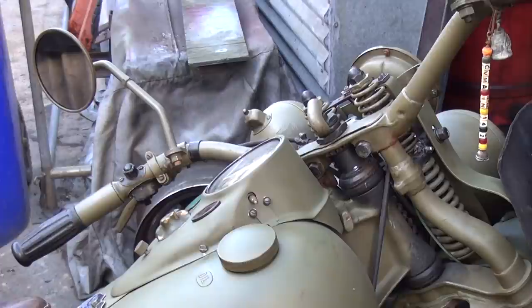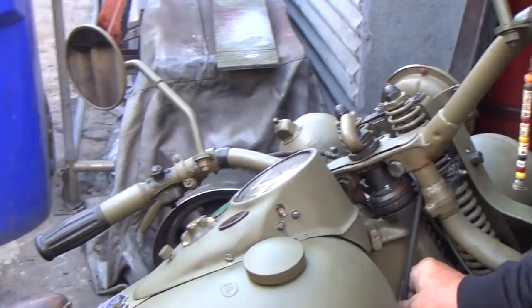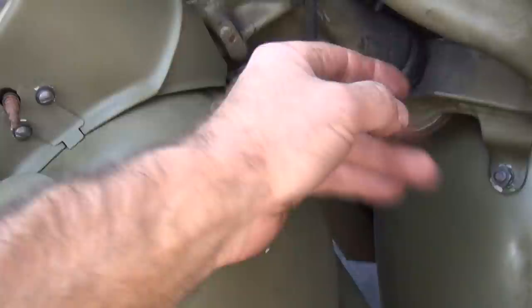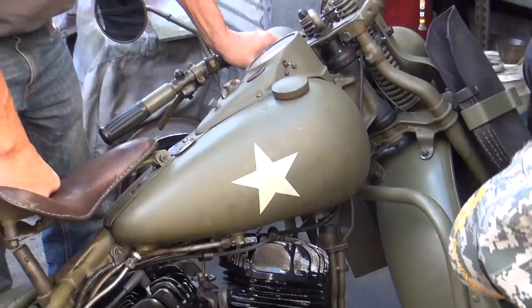you didn't check all this stuff to see what happens when you turn the forks. Now, is that a throttle cable coming down right there? Yeah. How come it's so tight? I don't know. It's not supposed to be a guitar string right here. It's supposed to have some looseness to it, so that it doesn't change when you change your positions. Well, unfortunately, we already cut the cable, so now we're screwed.